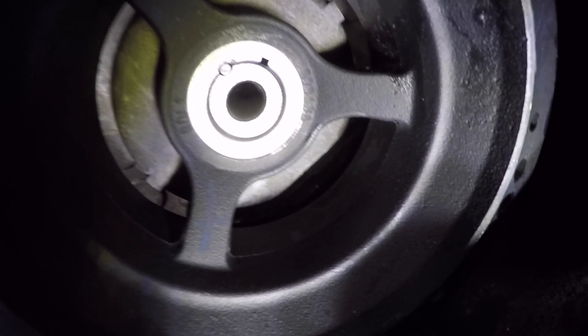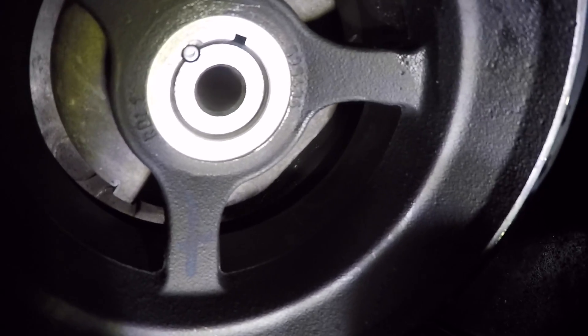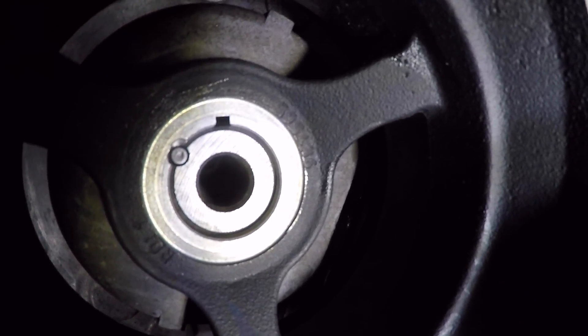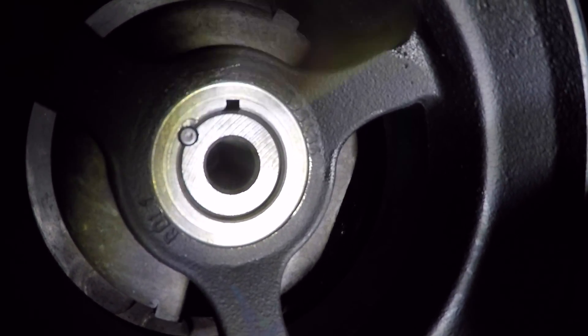The drilling is finished and the pin is in. I did decide to go with just one pin — it's a really hard angle to get at in the car and I'm sure I'll be fine with just one. I went in there, hit it with compressed air and some brake cleaner, got all the shavings out. You can see the pin right over there.